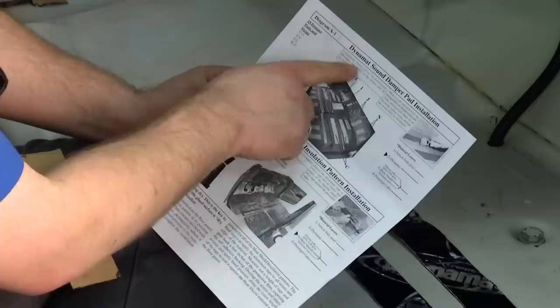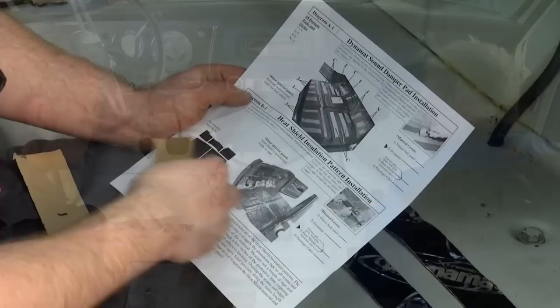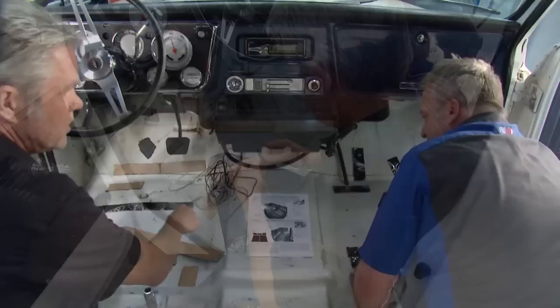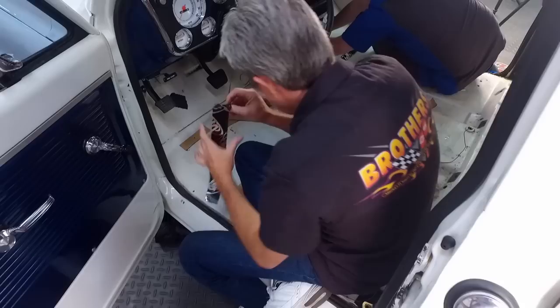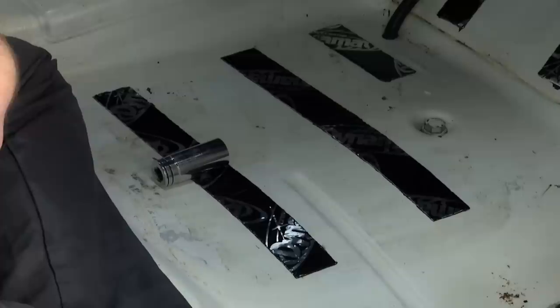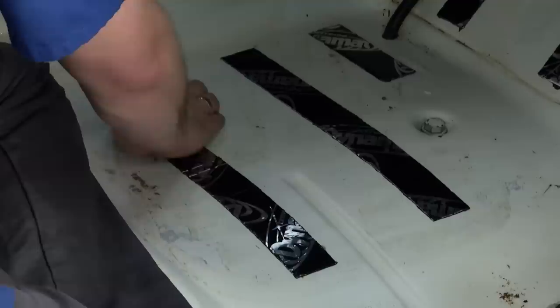All the kits from Brothers Trucks come with instructions — very easy to follow. We looked at the diagram to see where all the sound deadening fits in this truck, easily laid out, and we dry fit it first to make sure it goes in the right place. Start gluing too soon and you're going to make a mess — trial fit first, then glue down. Take your time with these — they can be hard to peel, and once you get them down, they're down. Really super sticky; you're not going to get a second chance. Use your fingers to mat it down, then roll it out. If you don't have a roller, just get a spray can or a really big socket and roll it out — make sure it's flat. You don't need any special tools.